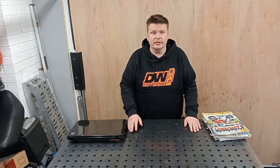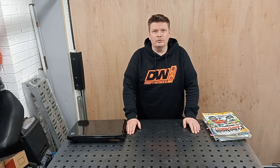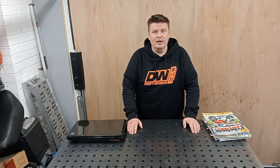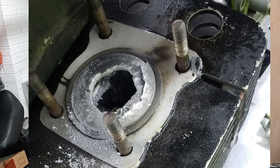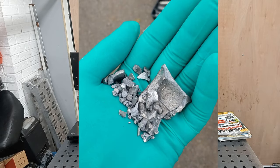I've done a lot of mods recently. There's also another big risk as well, and as you all know, the biggest risk with two-strokes is seizing, normally from detonation. So if I advance the ignition too much and try to get too much power, I might end up with a piston looking like this, which would be bad.